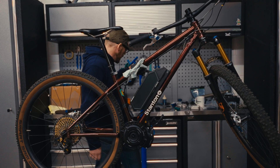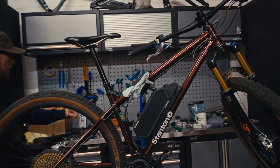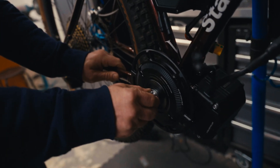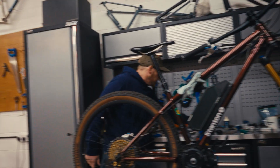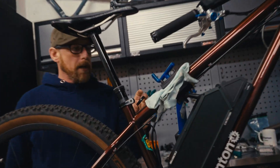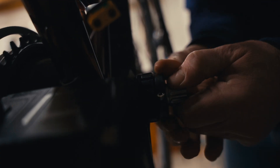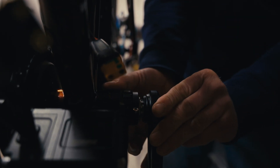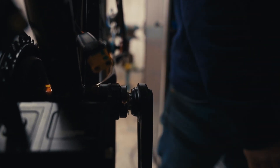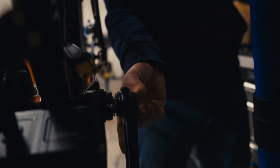So the next step then is — have a look — that looks good, it does look neat. Let's put the axle in. Rubber stop. Then there is a screw gate or a bearing compression thing here — just nip that up nice to the bottom bracket. Then the pedal arm, and then your bolt. I think that is an eight.